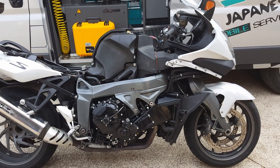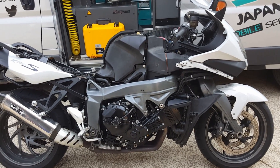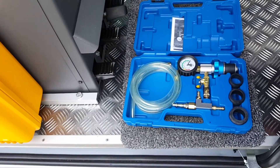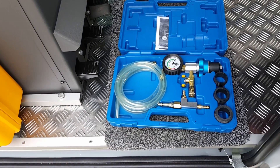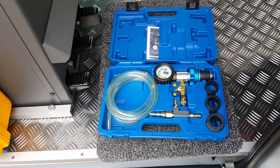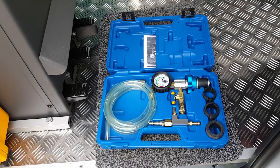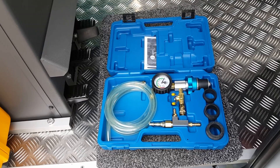These bikes are airlock central. Unless you use the right tool, you'll end up with an overheating bike. So the reason I thought I'd show you is you're going to need one of these — a coolant purging tool. Basically, you attach it to the filler neck and vacuum the cooling system. Using an airline and venturi effect, it sucks all the air out of the cooling system, then it's under massive vacuum, and you suck coolant back in using that vacuum so you don't get any air pockets.